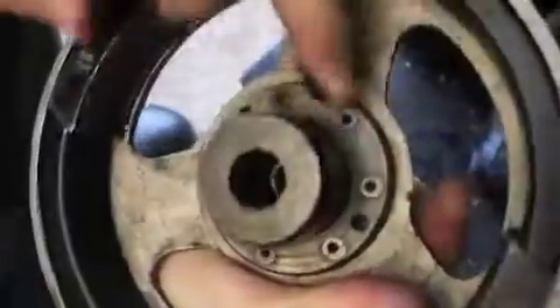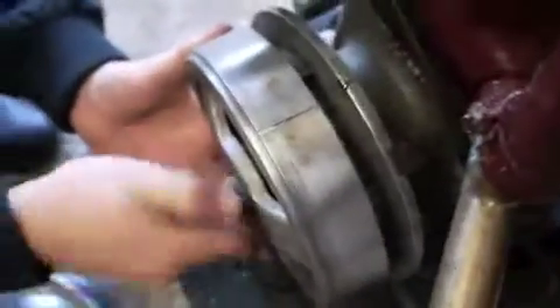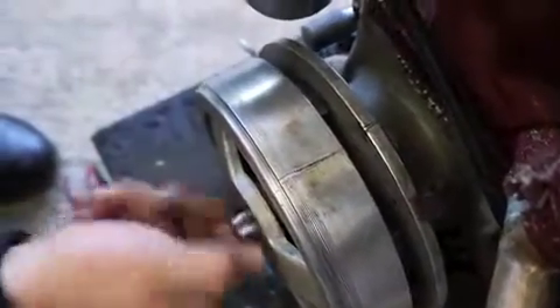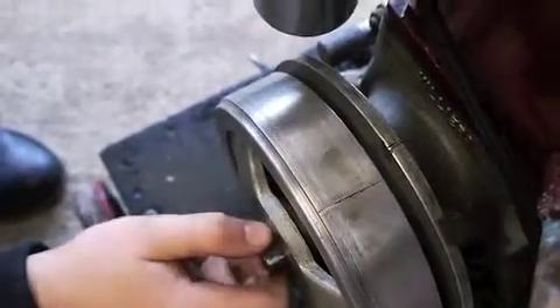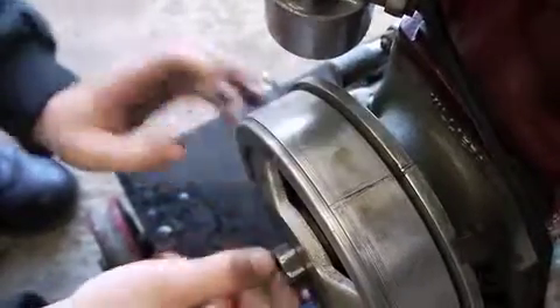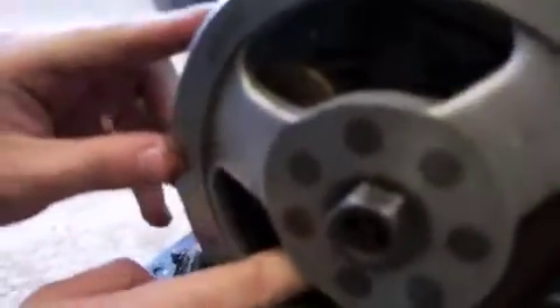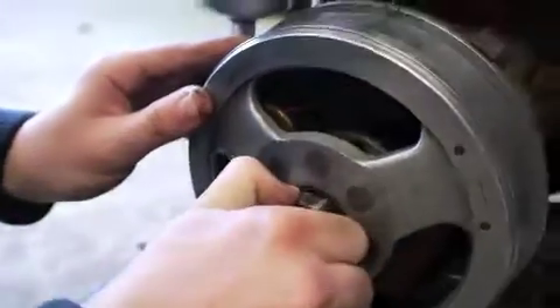So all your points are controlled by that there. The lobe is flat on it — the flat's up there. Put that onto TDC. Make sure we don't turn the flywheel too much on the other side. Do her up. Make sure the cam's on the lobe — I can feel it. So that's on that lobe. Should be alright anyway, but we'll double check.